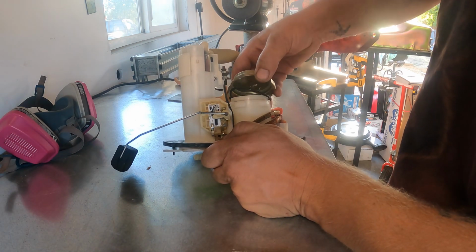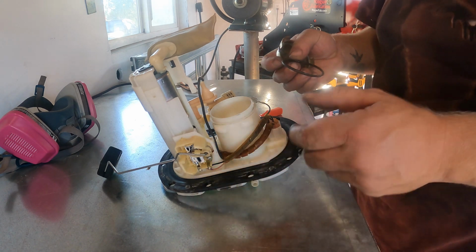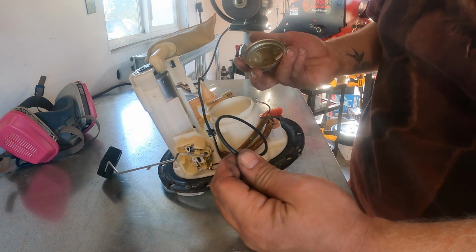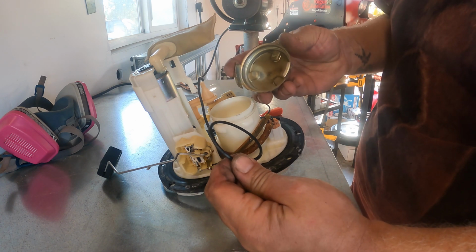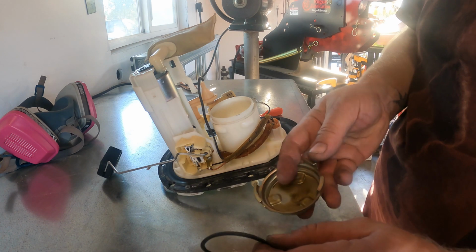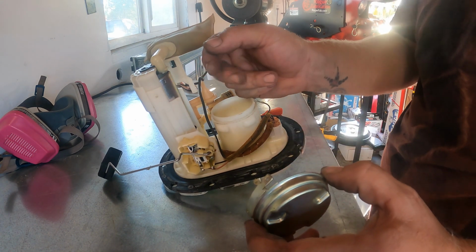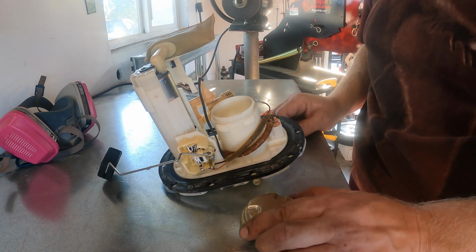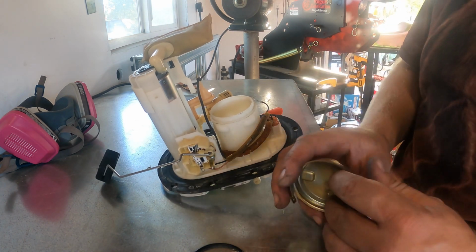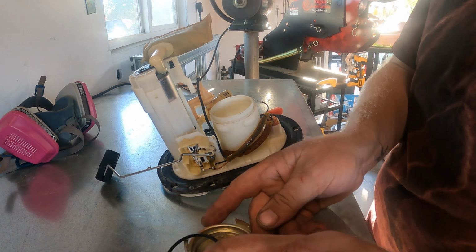Oh, did you hear that vacuum? That O-ring pushed out. Crack in the cap. O-ring pushed out. I've seen that exact same thing in a forum I just read. That is insane. So the pump was never bad, because it was performing exactly the same after I switched it. I don't know if a new gasket comes with it, but hopefully a new O-ring does come with it. I believe 3 parts, these 3 parts, but I'm not sure.